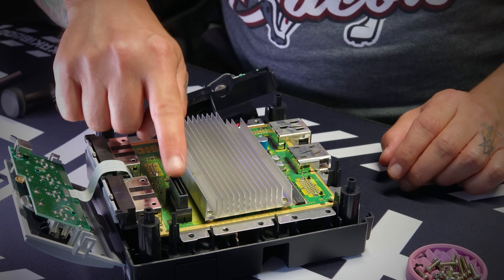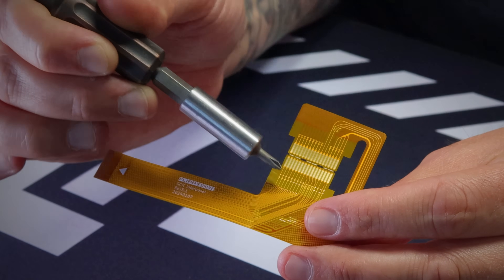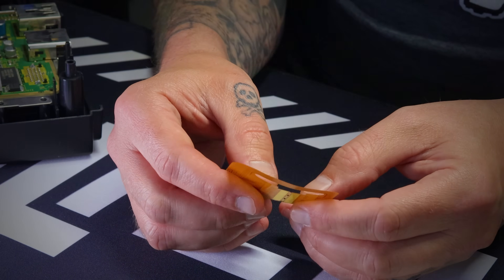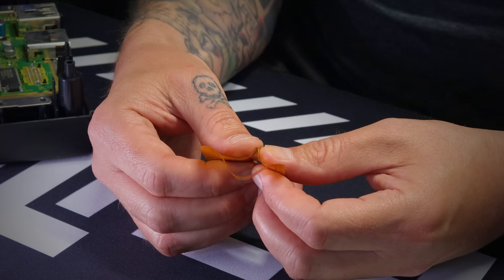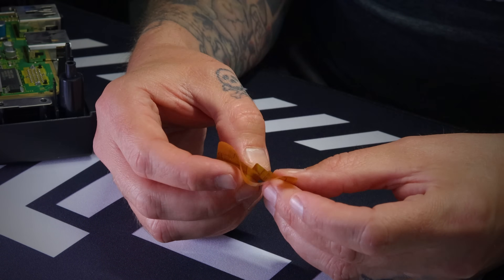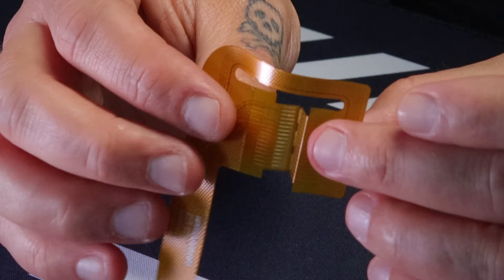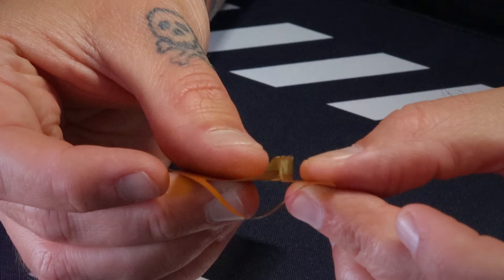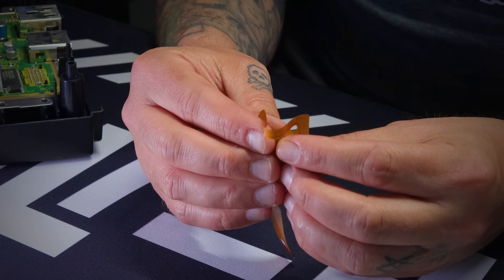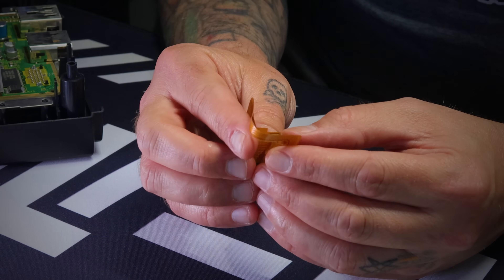Here is the port on the motherboard where we are going to be doing the mod. It's time for some origami — we're going to make three folds across this flex ribbon cable on each of these relief points. Start by making sure the arrow is pointing towards you, and make an upward fold in the dead center of the cable. You don't have to do it hard because we're going to fold it a couple times. Now fold either side against those reliefs, one and then the other. Notice how I'm folding the middle again as I do this — so you don't need to be super hard, especially on the middle. We've got a nice little V here in the center of the cable. Over at the edges there are two more reliefs, and we're able to fold the intersection once again to one side, then fold on the other, folding everything across to match exactly.